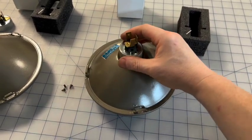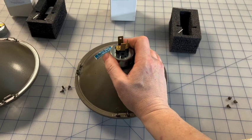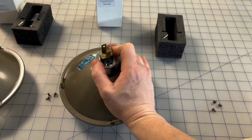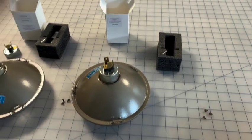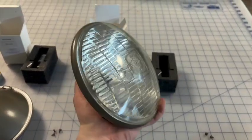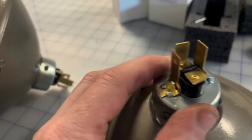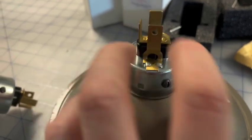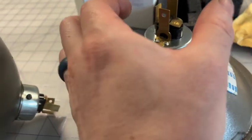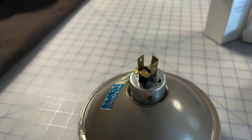I'm fitting the plug connectors - they go on a certain way and you've got to make sure all three tabs line up. There's a bit of back-and-forth slop even when it's locked in place, so I'm just going to press it down, hold it in position, drill three tiny holes, and put in these tiny screws to hold it tight. You'll have to pull the screws out to change the bulb, but at least it'll be held in tight so it makes good contact. I've now installed the tiny screws and that thing is rock solid - both contacts are fully engaged and spring-loaded, making good contact on both sides. I've done that to both units and they should be good to go.